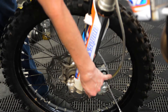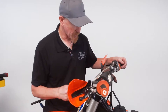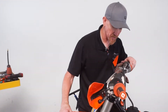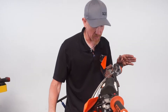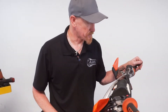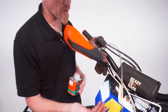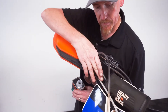If you'll notice, the fluid level in the hose is slowly rising. Once this fluid level equalizes up to the master cylinder, you know you have no air in the system. Right now we can tell that there's no air bubbles traveling up. We can give it a couple little pops just to see if there's any coming up through the master cylinder. There's some, so keep letting it rise. This does create a little bit of waste, but it also ensures that you actually have a properly bled brake system. The weight of the brake fluid — just its specific gravity — weighs more than air, so as it starts to drop back down the line, it's actually pushing the air back up to the master cylinder reservoir. So that means we probably did have some trapped right here in the rise.